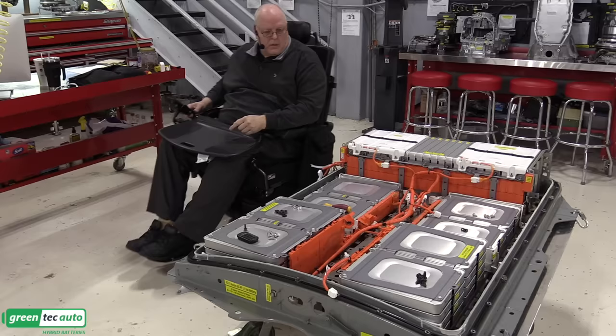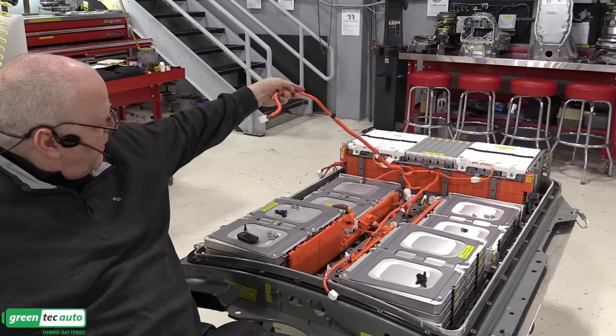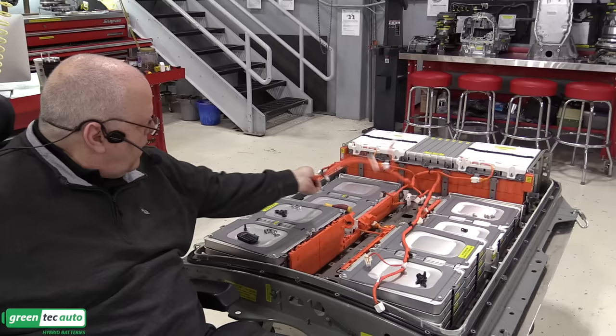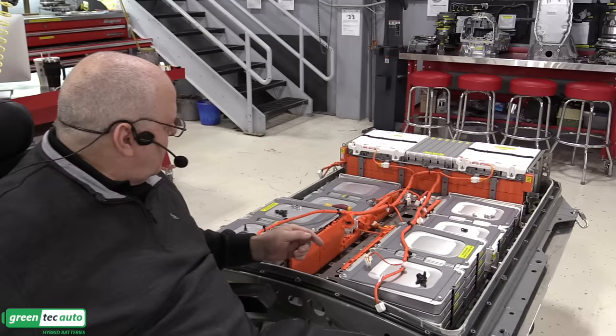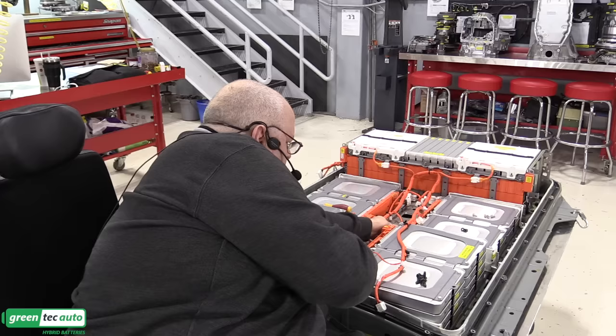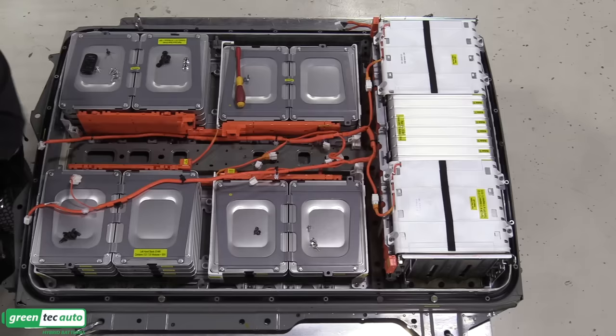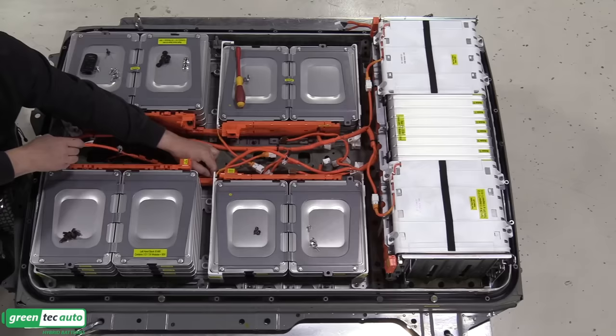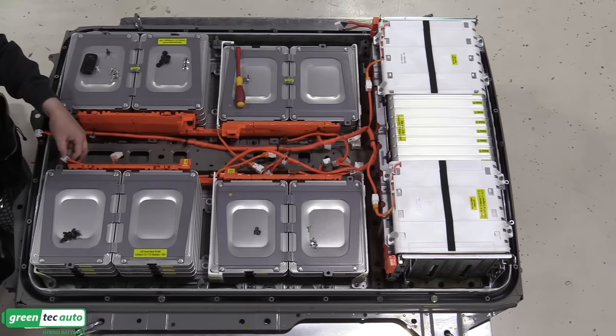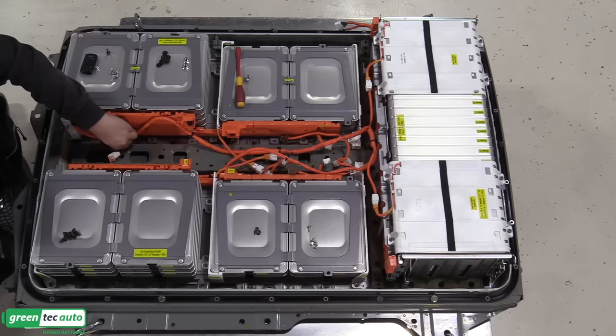And then, as I said, we have a left-hand side heater harness and a right-hand side heater harness. These have to go in underneath everything else, all the other brackets and other harnesses that we put in here. It's clear down to the very bottom. So we'll have to lift up other harnesses and tuck it down in. It has some little clips, harness clips that hold it in place. There's one. Another one. Then we supply power to the front heater with this connector. Power to the other front heater with this connector. Get our harness clips into their brackets.